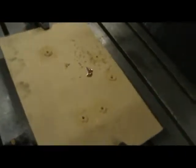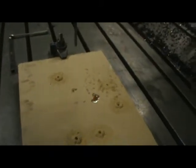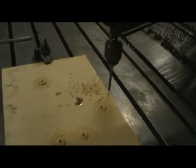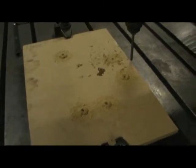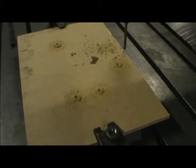We got our aluminum plate in, but because we don't want to ruin the aluminum plate, I bought a piece of MDF, and we're going to build an adapter out of this MDF. Instead of aluminum, we're actually going to drill it, we're actually going to tap it, we're going to shape the center, fit it on, take measurements, see how the flywheel is going to fit properly, because we've not made the flywheel yet. The aluminum for that should be in today.